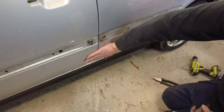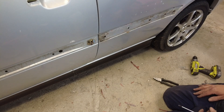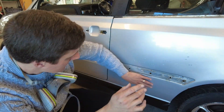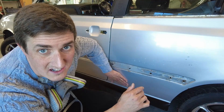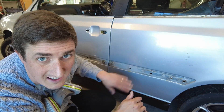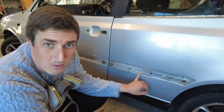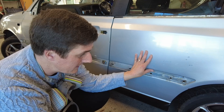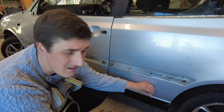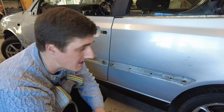When that's all rubbed down we'll get a better idea of what sort of damage we're looking at. I want to start sanding this area down. Although the dent is gone, there are still a few ripples and marks. There are also areas where it looks like it got splashed with something like a paint stripper — whatever it was, it needs to be sanded back. I'll get the DA sander on that with some fairly coarse paper — going with 120 grit at this point, then stepping up to maybe 400 for paint prep.